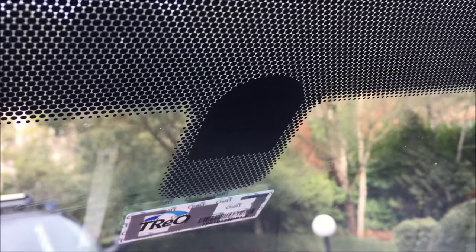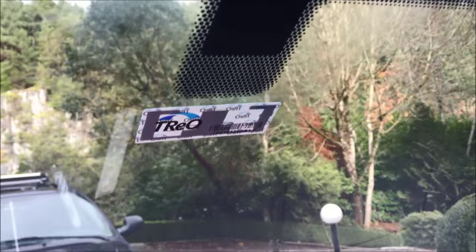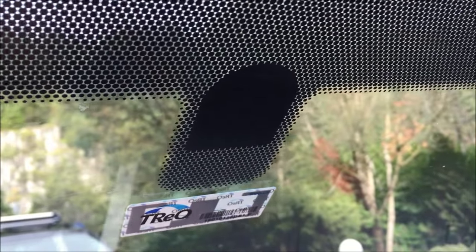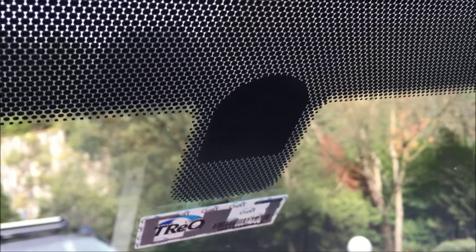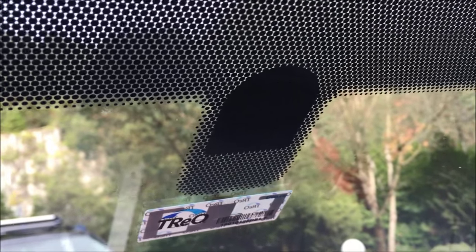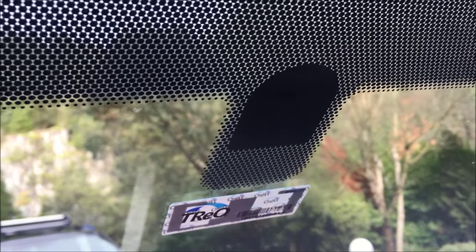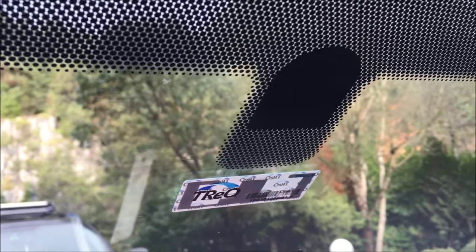While this is drying, I'll point out one thing. In this car, Toyota comes with a little cut-out showing where the rearview mirror should go. Some cars don't have that, so if yours doesn't, take a marker or masking tape on the outside of the car and mark where the rearview mirror used to be, so you can put it back in the right spot.